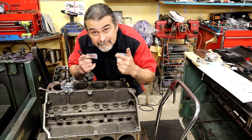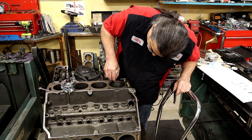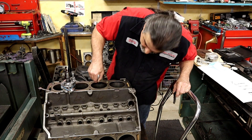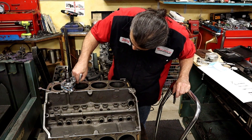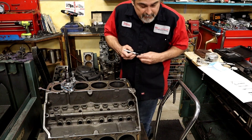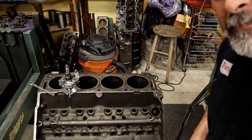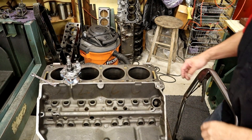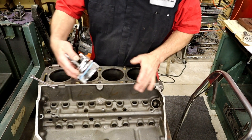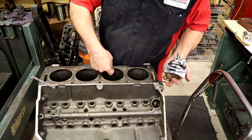All right, I'm going to be doing this side now — we'll be cutting the ridge on this side. I'm going to take a marker so y'all can see a little bit better. Let's get a little closer here. I'm going to go through the steps of setting up the ridge reamer. This is a ridge reamer — we bore the ridge. We talked about the ridge: it has a lip up there.